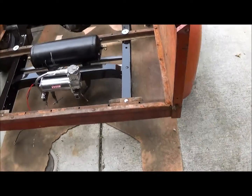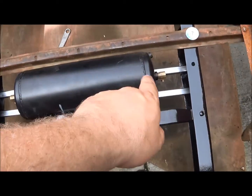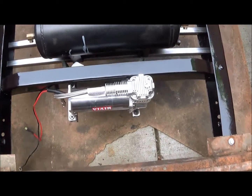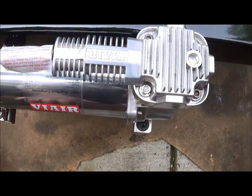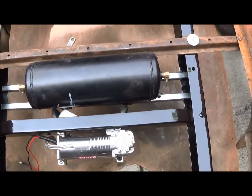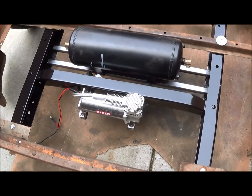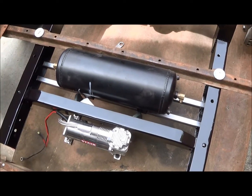After a little lunch break, here's what we came up with. We got the air tank mounted on some one-by-one stock, eighth-inch wall — might be three-sixteenths, I can't remember. I also have the compressor mounted on the same thing. It's just clamped on right now because I've got to get underneath it to drill a hole. First I've got to locate it dead in the middle, then locate the compressor dead in the middle, then we'll drill some holes and mount it. I didn't want to weld these braces because this is something that may move eventually, so we'll drill holes, bolt it through, and put a couple cross braces in — it'll be in good shape.